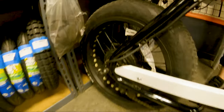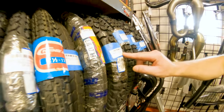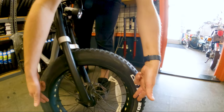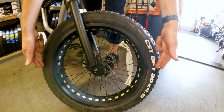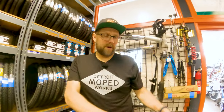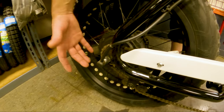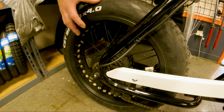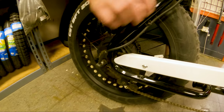The rear wheel is going to be a motorcycle style 17 by two and a half, using the Shinko SR244s. In the front, we're going to do the 16 by 3 SR244 — 16 being the diameter of the rim. One challenge is that putting the more powerful motor on here will create additional torque and perhaps compromise the rear dropout, so we need to add a torque arm. The Amazon brackets use hose clamps, so we want to drill and bolt through for a more secure fit.